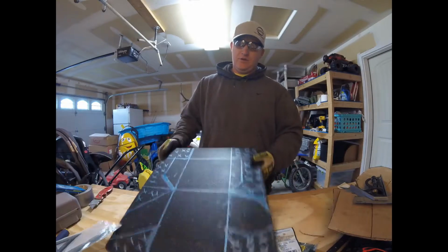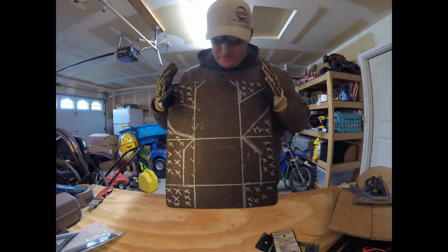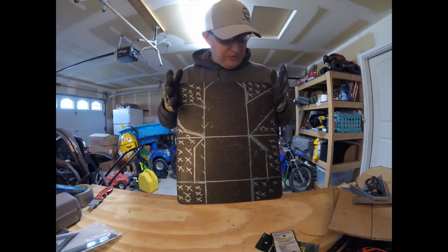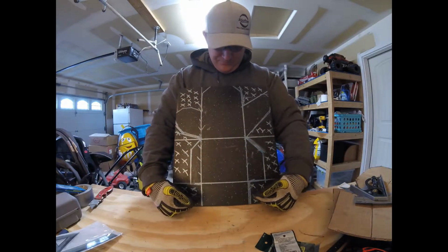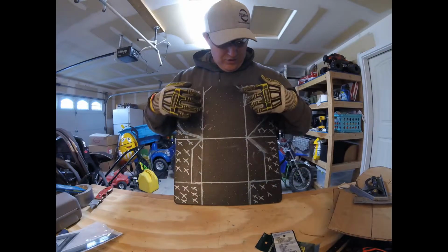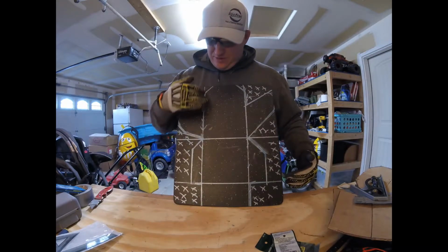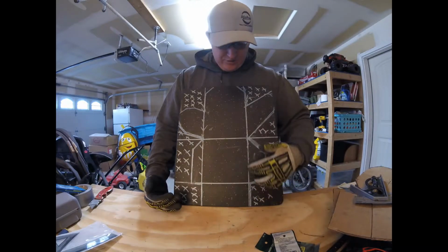Alright, so like I was saying, you wanted to make sure that everything was square because this is your final draft and that cardboard was your rough draft. So if you can see, down here on the bottom, our lines were off. We weren't square at all. So I had to go back through and measure from one edge, determined what the inside line was, right? Then 5 7/8 added onto that, and I squared up this line.